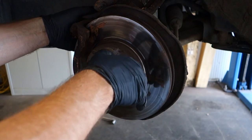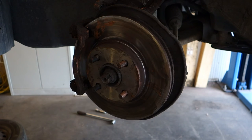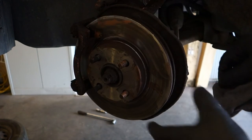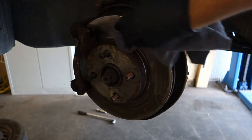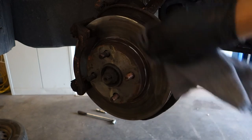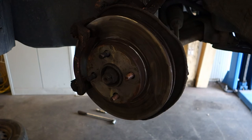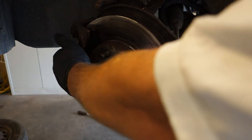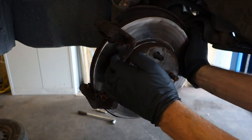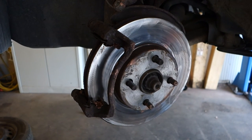And before of that, if we can see that there is this copper paste in here, we need right away to take this clean cotton cloth, and we need to take this away in here, because this grease is bad in this disc area. Okay, and then I change this position that we can install those brake pads.